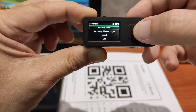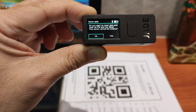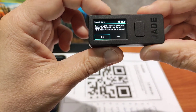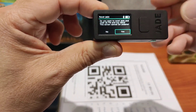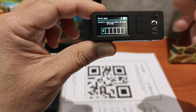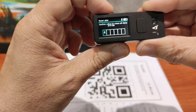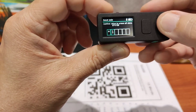We will do the factory reset. You want to reset, you want to clear everything, which is true. It cannot be undone, so think carefully — make sure you already have your backup. This is just to confirm that you do not accidentally press the reset. It will ask you to match the number that is shown on the screen. This is not your PIN, because when you reset, your PIN is not relevant anymore.